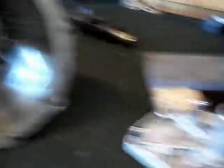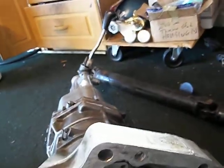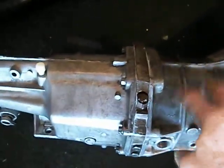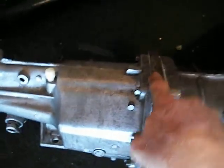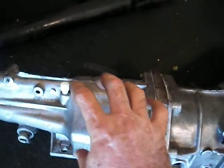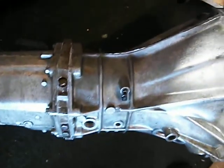That's the setup I'm using. The next process I'm going to do — I've already moved the front cover to get it out of the way — I'm going to pull the bell housing off and leave the rear extension. The idea being that the rear extension has a bearing support for the output shaft and the countershaft, at this bearing plate or adapter plate, and back in the tail shaft there's actually a socket where a bearing fits in. I'm hoping there'll be enough stability in these other shafts to hold them steady so as I spin it maybe I can see what's going on.